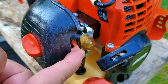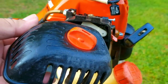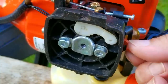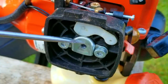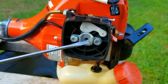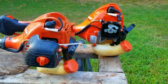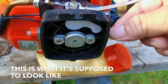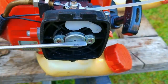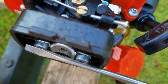Now that it's clean, I think it's time to tell you what I think happened to the choke lever and the plate it's hitting. On this particular design, the air filter cover attaches to the plate that's hitting the choke flap. So if this trimmer was unsecured in the back of a truck and free to slide around, repeated blows over time could push the plate in the way of the choke flap. The fix is pretty easy — we can either replace the plate with a new or used one, or try and bend the plate back to its original shape. I have a parts trimmer available, but I really want to get that one back up and running too, so that only leaves us with one choice: my favorite tool, my hammer.